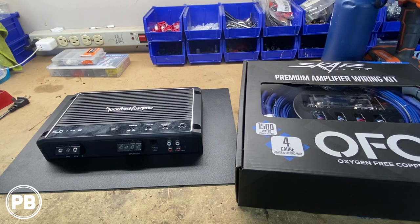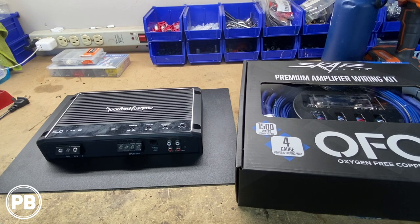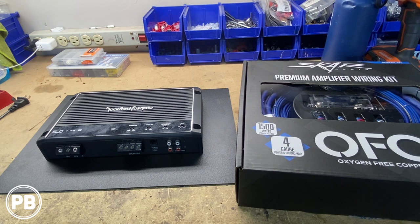Now, to wire everything up here, we do need some sort of wiring kit, and based on the current draw that this is going to pull, for a 4-gauge, we want OFC. So we went with the Scar Audio amplifier wiring kit. It's oxygen-free copper. It's a 4-gauge kit. Comes with power, ground, remote wire, RCA, speaker wire, fuse and fuse holder, all the accessories to get it installed